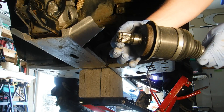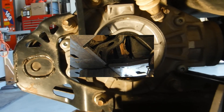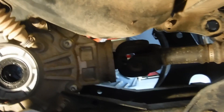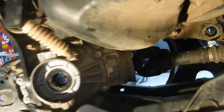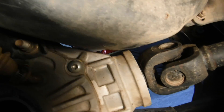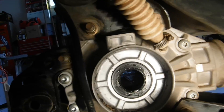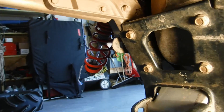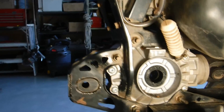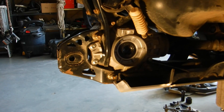There's your little C-clip that everybody talks about — gets locked in. That's looking right through your rear diff. There's your drive shaft. You've got a little nut in there — that little nut holds the yoke into your rear diff. Five big bolts through the rear diff and then four bolts up there. Those all have to come out and then the rear diff will come out once we take that yoke bolt out. That was maybe half an hour of work.